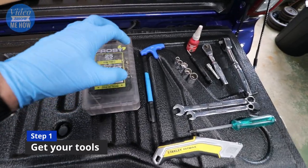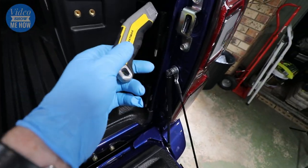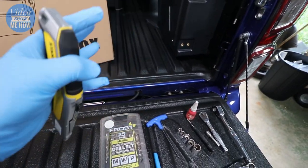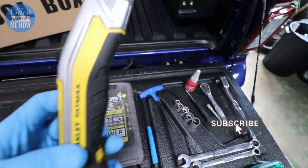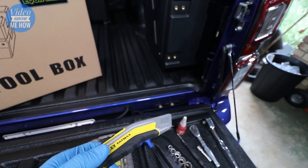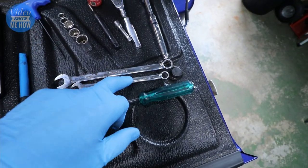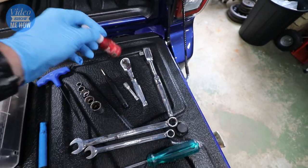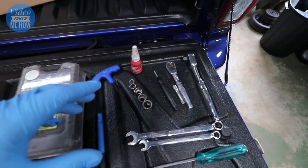The tools you're going to need for the install: a bunch of drill bits, a mark-out pen, a Stanley knife - mainly to cut away the drop-in bed liner. If you don't have a drop-in liner or you're rocking a Raptor coat, you probably won't need the knife. I actually used a Dremel when installing this one but a Stanley knife works fine too. You'll also need a Phillips head screwdriver, a 10mm and 13mm spanner, and sockets in 7, 10, 12, 13, and 14mm, plus some red Loctite, a hole punch, and ratchets.